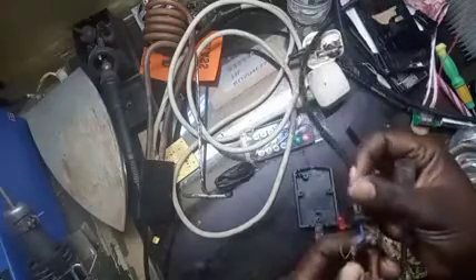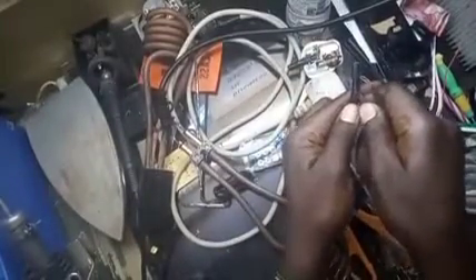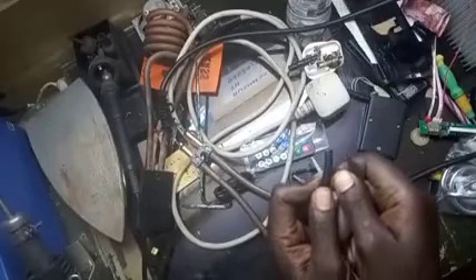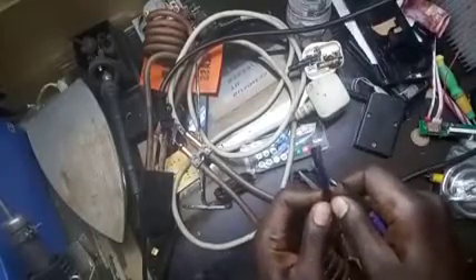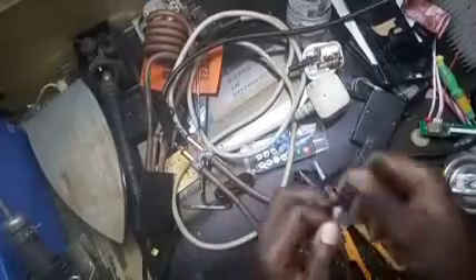So let us check — we are trying to check if the connection is good and if the coil is still alive before we do our fixing. The next thing we are going to do is check the continuity of the wire, to see if the wire is still fine or if we also need to replace it. After doing the continuity test, we will know whether we have to change the whole wire or just the plug only.